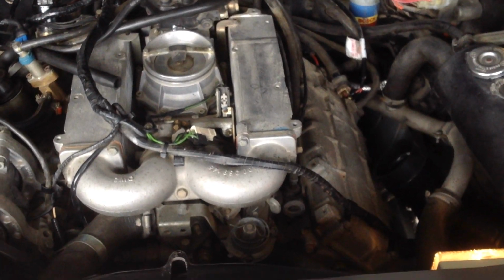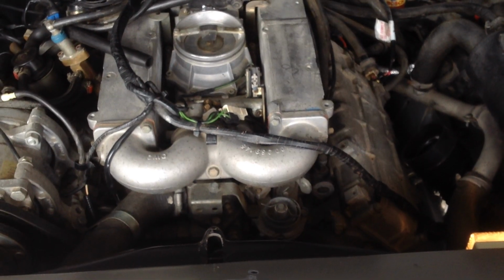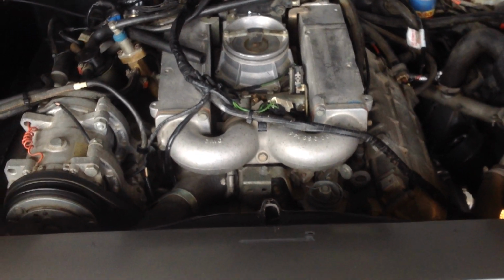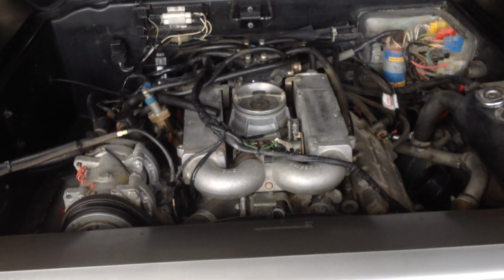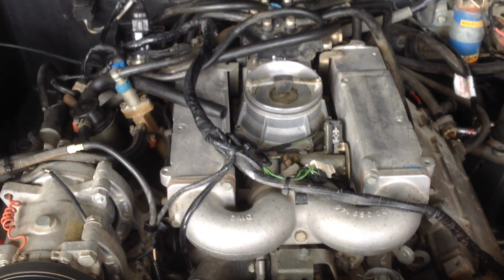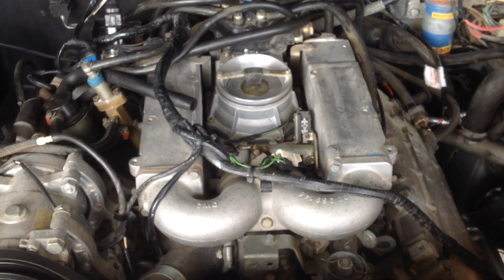I'm going to go ahead and kind of goose the throttle a little bit, see if I can get it to warm up a little quicker so that maybe you guys can see what it's doing. Oh, there we go. Actually, I didn't even have to do anything. So once it starts warming up, the idle will start slowing down. Seems like the Lambda is trying to catch up with it. The dwell readings that I had given before also showed that in the number 2 video.